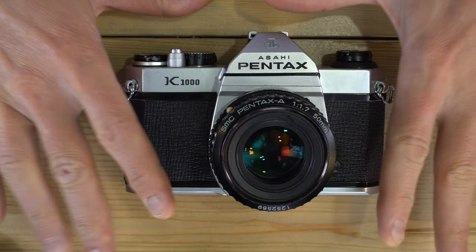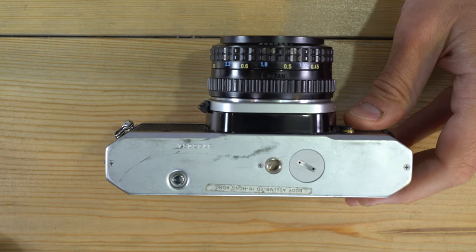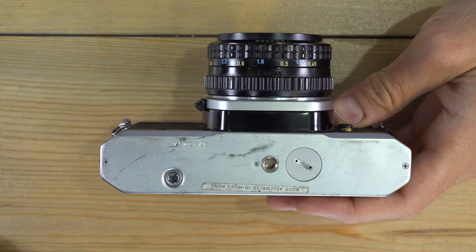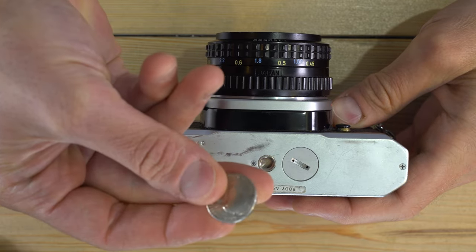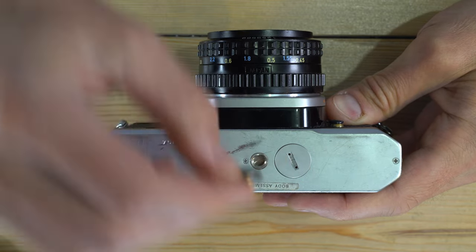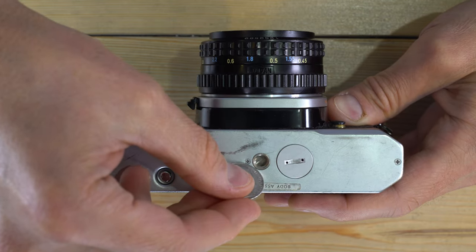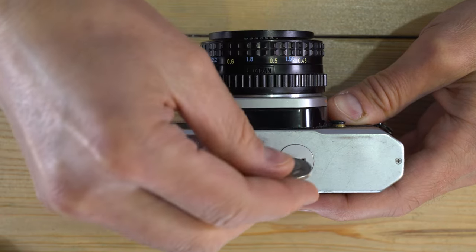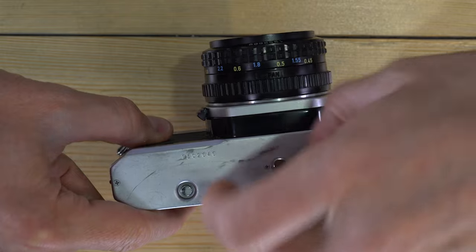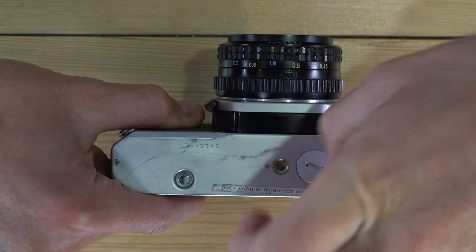You only need a battery to power the light meter. We're going to start by changing the battery. Here's the battery chamber — this is a US nickel, it works really well for unscrewing the battery cap. If you have a made-in-China version of the K1000, this is a bayonet and you only have to turn it about a quarter turn. It's a lot easier to do when the camera is upside down, because gravity works with you.